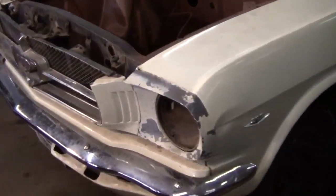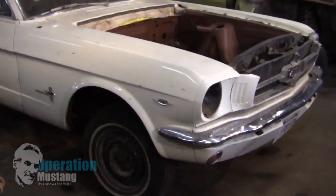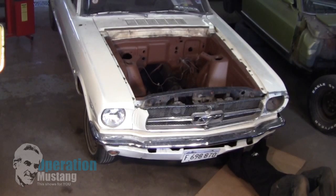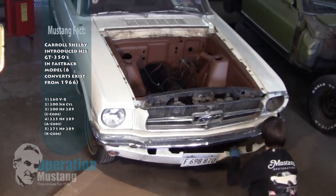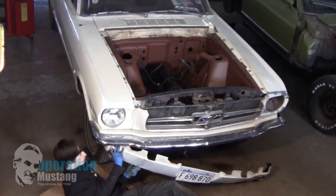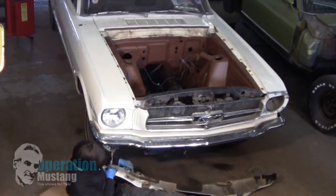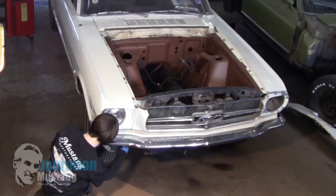One of the things that makes these old cars — these Mustangs and hot rods — such joys to work on is they're simple cars. The front end of an old Mustang does not take a whole lot of tools or time to disassemble. All you've got to do is basically get underneath the front of the car with a half-inch wrench or socket and a 7/16 socket. That'll lower down the front valance panel — the panel you want to remove first. You'll unplug the wiring, then inside the fender just behind the bumper you'll see where the front valance gets lowered and removed.